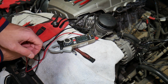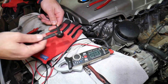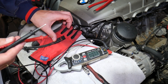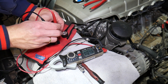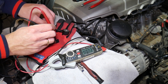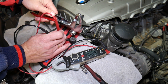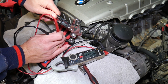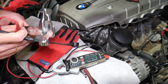What I'm going to do now — I'm going to turn that knock sensor facing upside down and get the probes. Touch the red lead to one wire, black lead to the other wire, and you're going to get a low voltage. Now, what will happen if I hit that sensor with a metal tube — just tap on it — you will notice the voltage will go up. Now this is a bad sensor — it doesn't register almost every time.